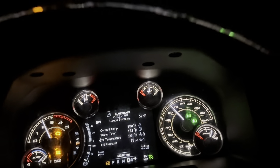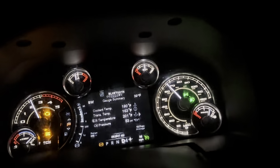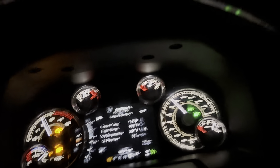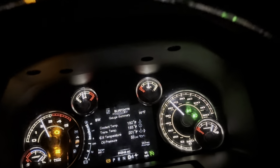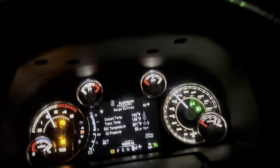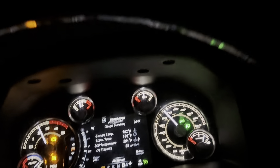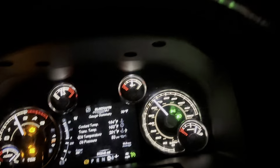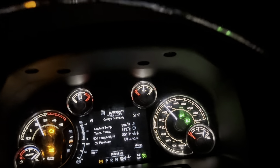If you keep your engine cool — meaning once you pull a hill like this, don't just pull over and shut off the truck. Once you've towed with your vehicle, let it idle. Let all those metals come back down in heat. Just because your coolant temp dropped doesn't mean you're good to go. After you've towed and your metals are nice and toasty, as soon as your coolant comes back down to normal, shut it off. Come back five minutes later and look at those numbers — they're going to be significantly higher. For example, if you shut down at 188°F, you'd come back to 195 or maybe even 200. That tells you the metals are still hot and the oil still hasn't pulled all the heat out.